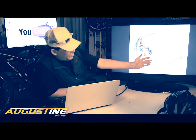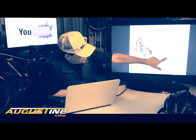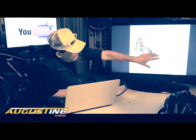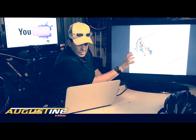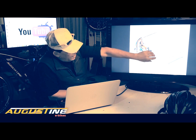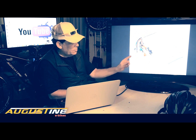The third piece, which is the brains of the operation, is your controller. This is about eight inches long by about three and a half inches wide and about an inch and a half deep. This is pretty much plug-and-play. These pieces control everything from your pedal assist to your brakes to your motor and more. Very straightforward and very easy to connect. You can mount it under your down tube or behind your seat tube, depending on how much space or the configuration of your bike. So you need the controller, the battery, and the motor — and a bike. That's what you need.